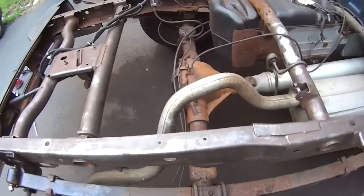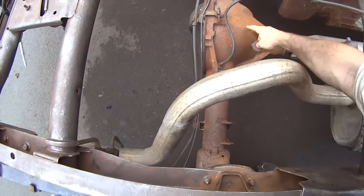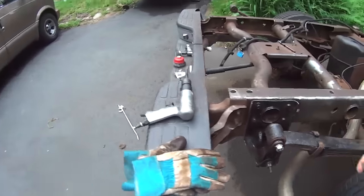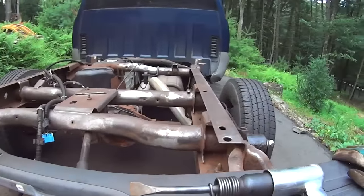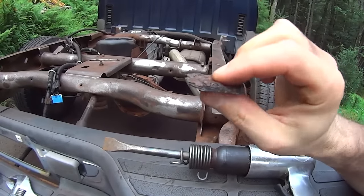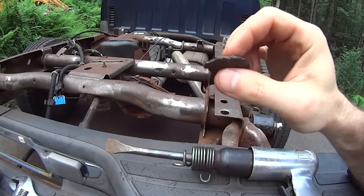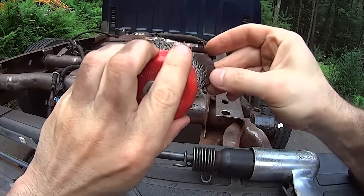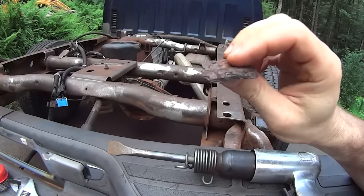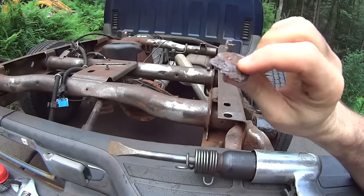This is a differential case. You see that nice and orange because I peeled all that stuff off. It was like that and this is cast iron. When it starts rusting it just really rusts. Most steel everywhere — the frame, everything — when it starts rusting really bad it turns into a rot, just layers. The rust expands and you have these multiple layers. If you take a grinder and hit it, it'll make it nice and shiny, and you might think you have clean metal to paint, but in fact you have paint on top of rust and water will penetrate it and keep corroding.